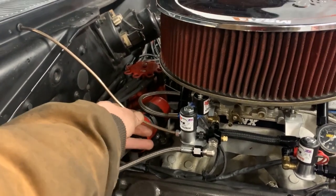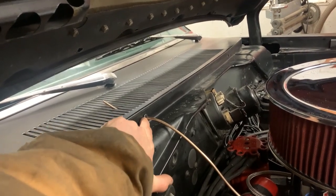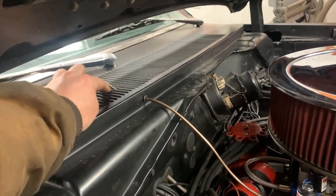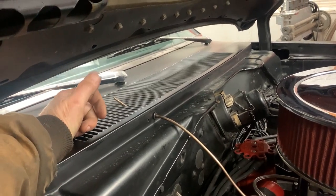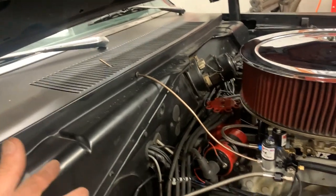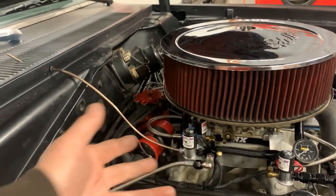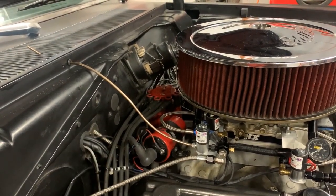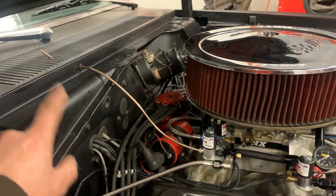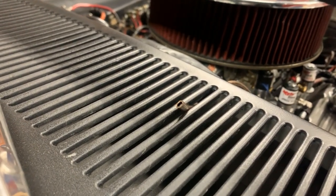As you can see, this is not bottoming out in there. I put a grommet here where the wiper washer goes, and I crimped this end down so it will fit up between the slats. When I hit that purge button, we'll get a little purge out of there. Since this is mainly for drag and drive events, I'll take this out after each event, put a cap in to keep moisture and contamination out of the solenoid, then simply plumb it back in and tighten it up at the next track. That is my nitrous purge setup.